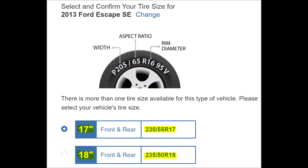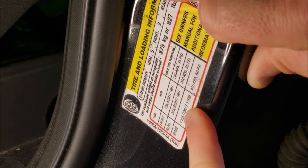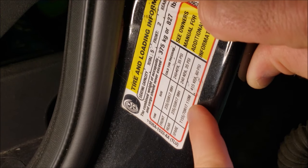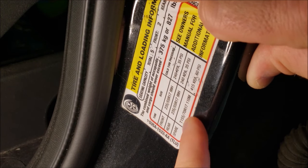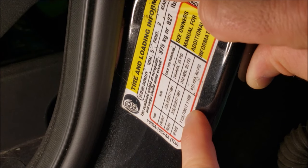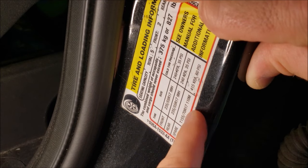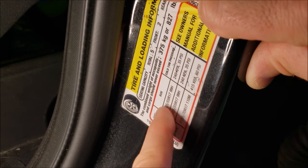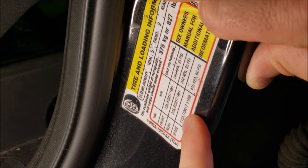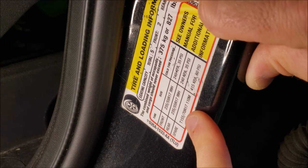The resultant diameters are the same for the 18-inch setup, but there's a difference in sidewall and rim size — 70% aspect ratio sidewall height relative to width on a 17-inch rim. The spare tire is rated to go 50 miles in an emergency, and you're not going to compromise your all-wheel drive system with that slight variation in diameter compared to your main wheels. I did consult a dealer and a few others about that just to confirm.